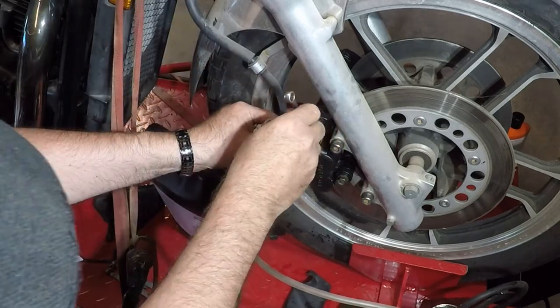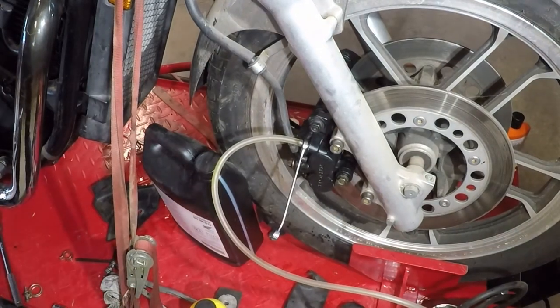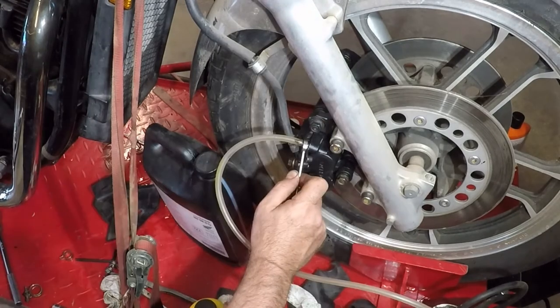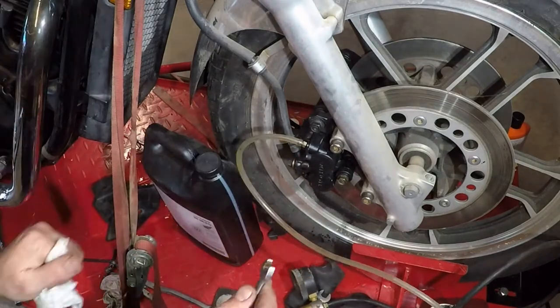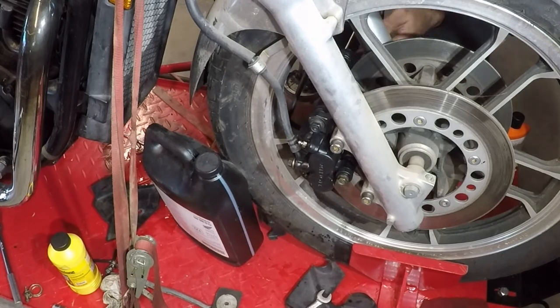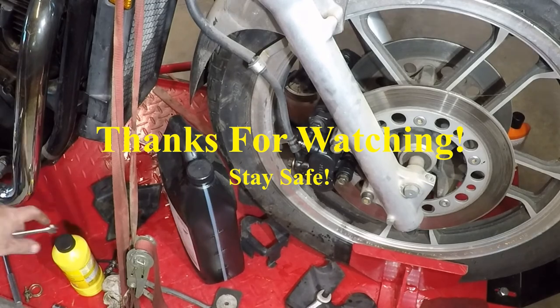Hi, this is Walkster1970. As you can see in the last part of this video, I was working on getting the air out of the front caliper assemblies. The way I accomplished this was squeezing the front brake lever until I built up pressure, and then holding that in place while reaching down and opening up the brake bleeder valve. I kept doing that until eventually I got all the air out of the system. Everything is working now on the 1983 Honda Shadow VT750C, and I will have more videos on this later. I hope you enjoyed this video — please like, share, and subscribe. Stay safe, thanks for watching.